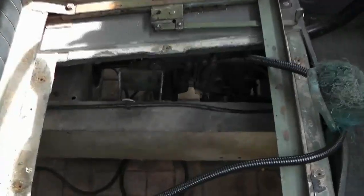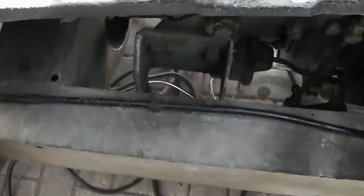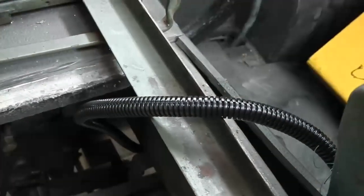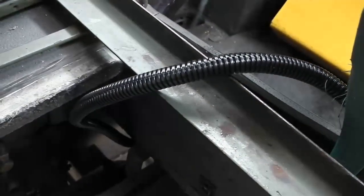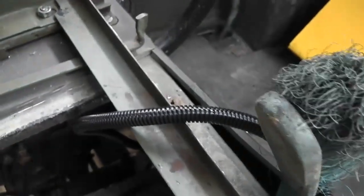I'm just starting to look at where the auxiliary fuel tank is going to go. You can see the main fuel pipe from the rear tank where that runs, so that's actually going to be changed. The fuel tap goes about there. This is my cable to the load bay winch I use for loading the stationary engines. The tank fits so tight to the seat box I've had to unclip it and put it in some smaller conduit - about half the diameter that I'd used previously.